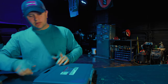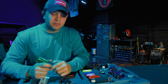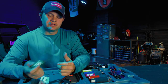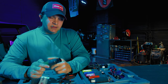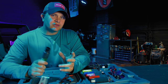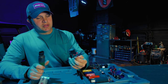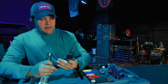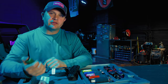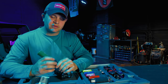The next thing I have is a fuse saver kit, mostly for gas trucks. The operating voltage limit is 14 volts. If you have a short circuit somewhere and you're blowing fuses, these are basically circuit breakers — you hook them up in place of the fuse so you can track down your short to ground without going through 500 fuses.